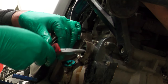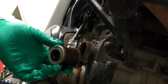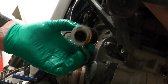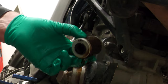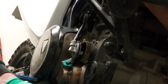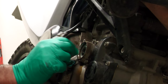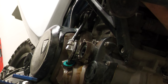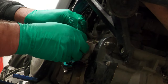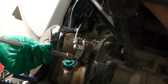I'll use my pliers to get this filter out. With this filter you've got a rubber stopper either end, which you didn't have on the other one, and there's writing — probably part number and brand — so it makes sense to put that facing outwards. Drop that filter in there, work it in, and you can just feel it push into place. Then just screw these up by hand so you don't accidentally cross-thread anything, and I'll do these finger tight again.